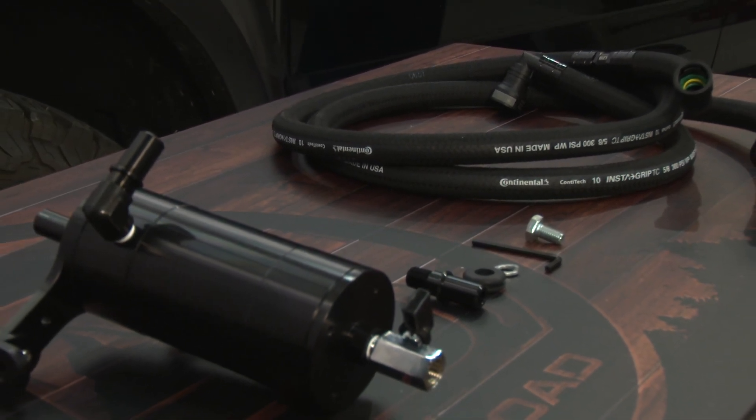Using a little bit of WD-40 will make this a little bit easier. Before you actually install this back on the Raptor, make sure you clean it out with compressed air or water — make sure it's nice and clean, then you can reinstall it. Reinstall the inlet pipe the same way that you removed it and tighten both clamps. Once you get the inlet tube installed, you can connect the wide open throttle line to the fitting you just installed.